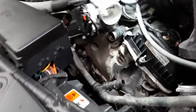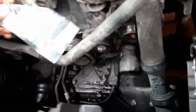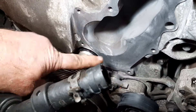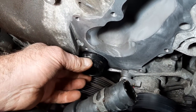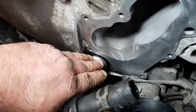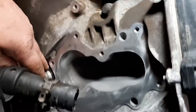That one O-ring — the orange one I showed you — does not come in the kit. This is the one that goes right there. And the seal, which goes down in the bottom — this right here goes into the bottom of the water pump. That seal right here is actually part of the timing cover. This whole piece is the timing cover — this gets pushed inside of here, and it not only acts as an oil seal for the timing cover, but it also creates a permanent seal or barrier that would stop coolant from going into the motor if it were to leak.